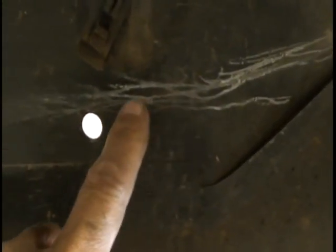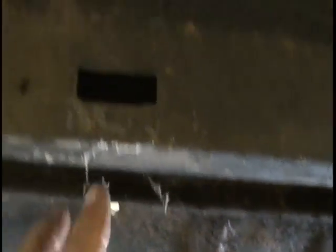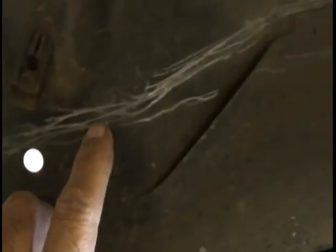Here is the hole coming right across the top of the inside on the driver's side. We showed you from the inside view. This would be our bottom cut. What we're trying to do, this is 1 inch in front of our gas tank strap holder, which holds our gas tank straps, which maintains our gas tank. We do not want to trim this out, so this is why you follow the instructions as I tell you from the top cut and the bottom cut. We'll be maintaining this. That'll be our bottom cut. Straight back up 6 inches from the back of the hole, back up. And there's our 1-inch lip on the top side. This is just a bottom side view of what we viewed from the inside. That's all this is. Verifying the way it's going to be.